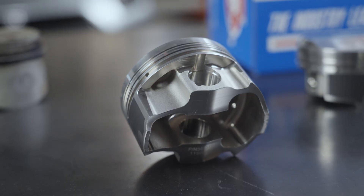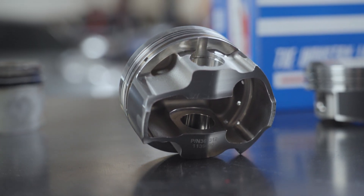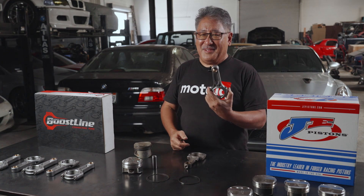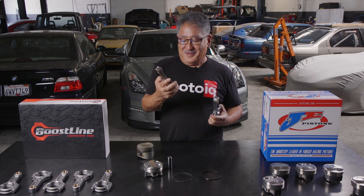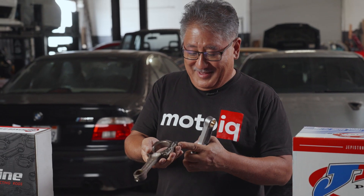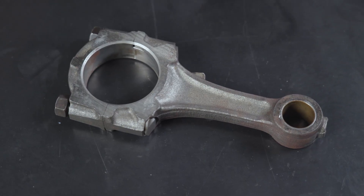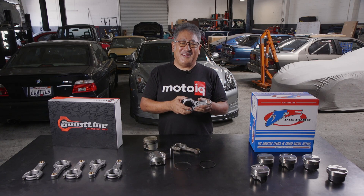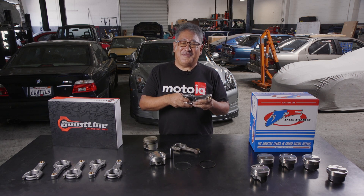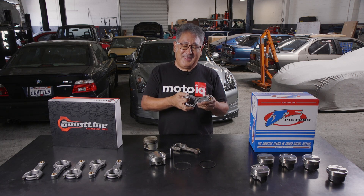It's a cool feature found in newer high-performance pistons, and other than that it's pretty straightforward — though it still has excellent cutting-edge features like the asymmetrical skirt, slipper skirts, and the low-noise skirt contour. When you're building a strong turbo bottom end, the rods are really important. The stock RB rod isn't too bad — it's a forging, it has broached bolt heads and pretty decently sized bolts — but it's still maybe the weak point of the bottom end after the piston. So to get around the inherent weaknesses of the stock rod we're using Boostline connecting rods, which are specifically designed for engines that have a lot of boost.